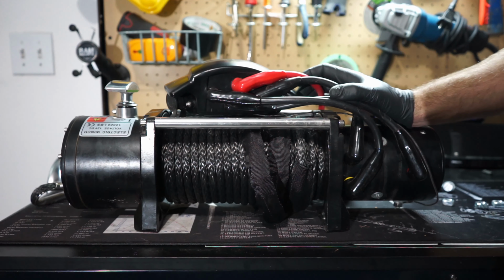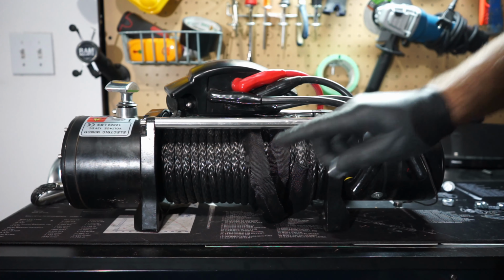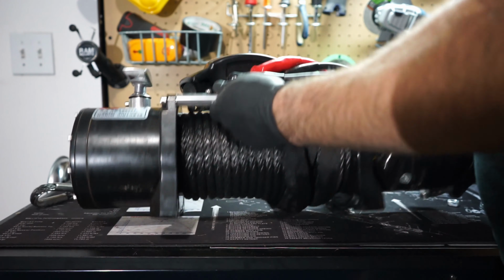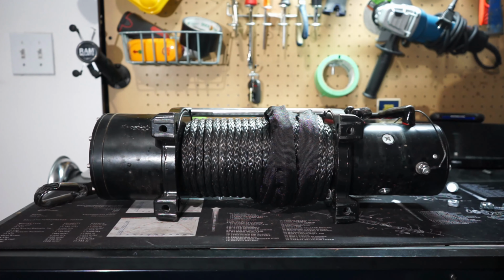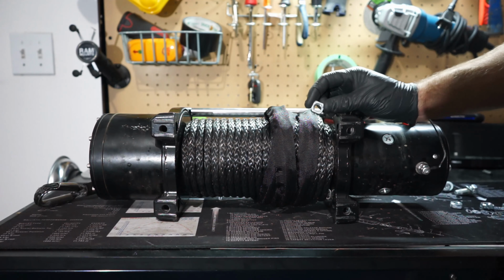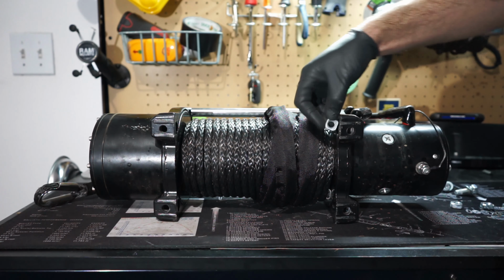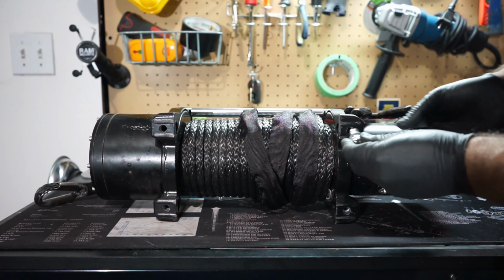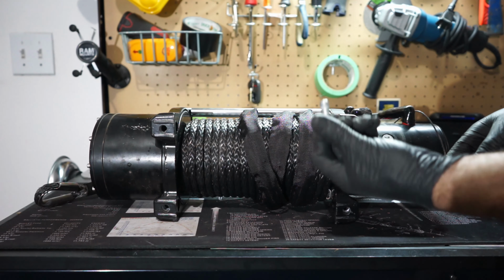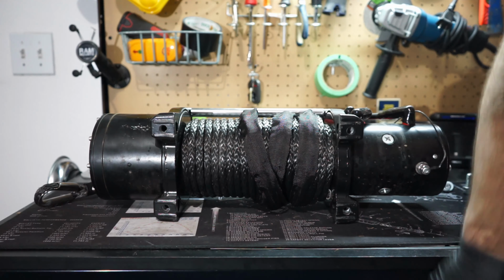Now, before you mount this in the vehicle, you're gonna want to put these guys into the spots for the nuts, in these 4 places, because that's where your main bolts that hold it in are gonna go. They're not fun to try and do when it's already in place. So you'll just slide these guys into their little spots, and they do move around a little bit, but you'll be able to wiggle the bolts around till they thread in. But you don't want to do that after. You want to do that first and then get them into the vehicle.